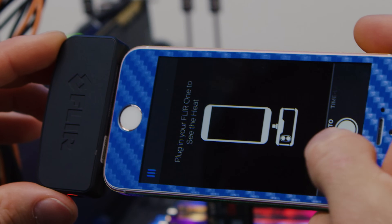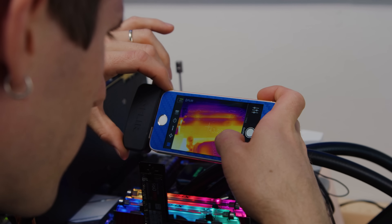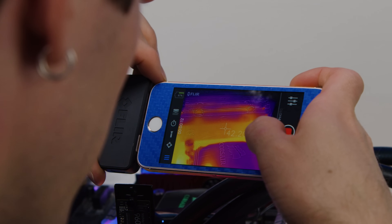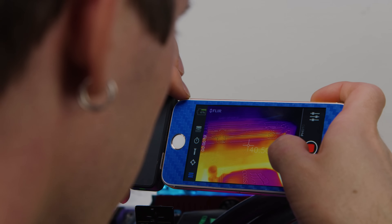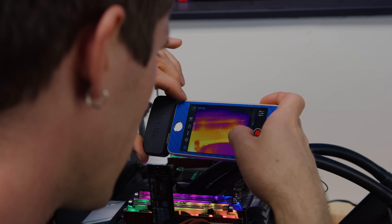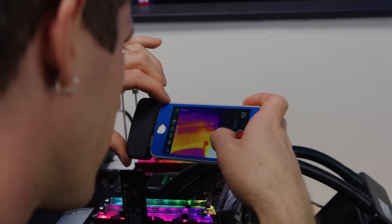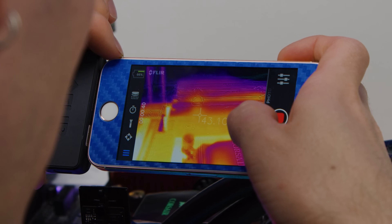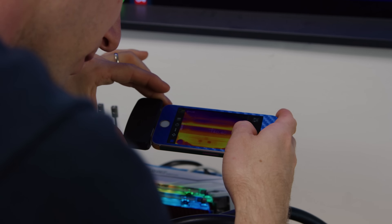Hopefully our FLIR camera will tell us some interesting things about what's going on here. We can see the heat is clearly concentrated directly over the actual DRAM modules. The second thing we can see is that my suspicion that there was some kind of contact between this medallion here and the water cooling at the top was probably not correct. It looks like the only places where heat is being transferred up into the top chamber are kind of over here and then kind of over here — those are almost the same temperature as the spot directly over the chips. And you can see, if we look directly over top of it, the water cooling portion is still quite cool.